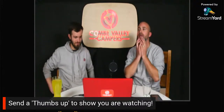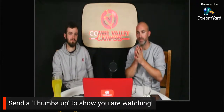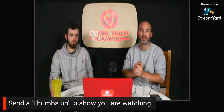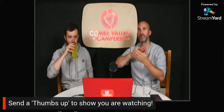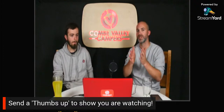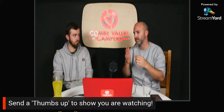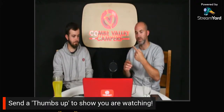Not really. So, secrets. I dry fit your panels with screws in convenient places, and then if you want the hidden screws but still have the facility to undo your panels, you can use the hidden screw method. Once you've dry fit your panel and got all the holes in it, you come to carpet it. When you've carpeted the side that is on show, poke a pick tool or a screwdriver, something thin and small, through the hole from the back so it pokes out the carpet at the front where you want your hole to be.